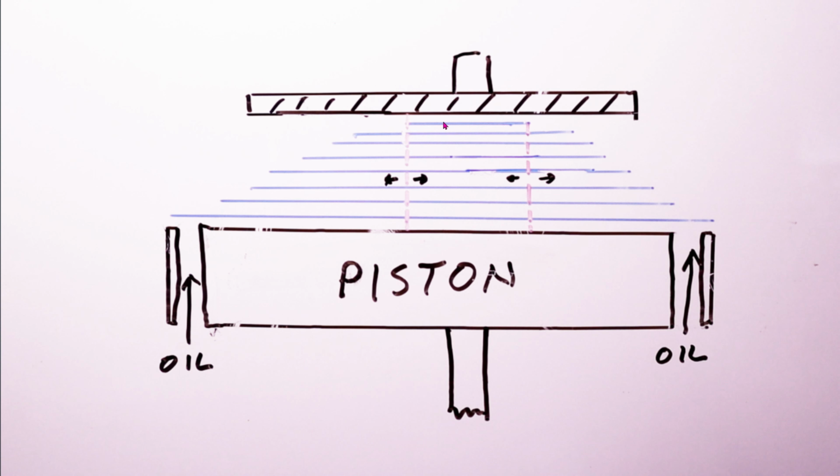Now, if you put a different size clamping shim, let's say you put a smaller clamping shim, and now that little red line comes down inside here, well, there's more shim to bend. So therefore, this whole stack gets a little softer, a little less damping. It usually keeps the same characteristic. You've worked really hard to get this looking like you want on the dyno, but I want to leave the bleed open, and I want a little less damping, and I don't want enough less to change the shim stack down to the next smaller shim. So you go in and you put a little smaller clamping shim. And I'm going to show you this on the dyno. Same goes the other way.